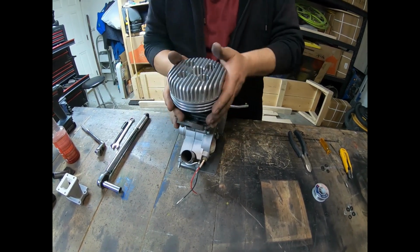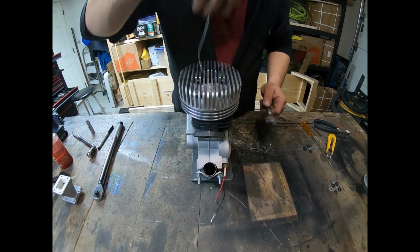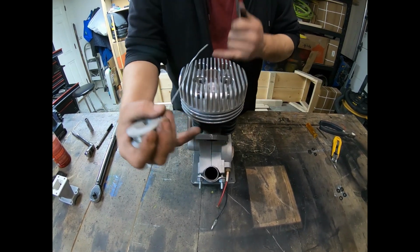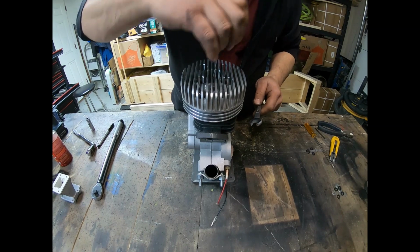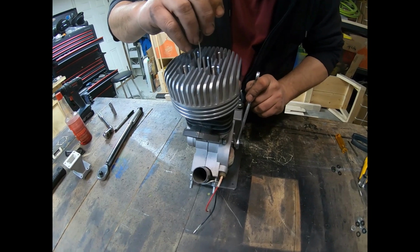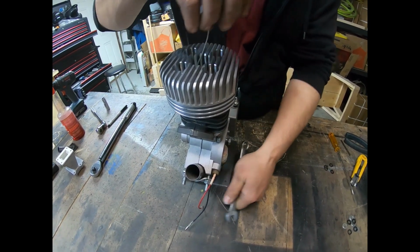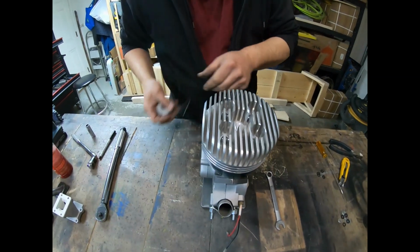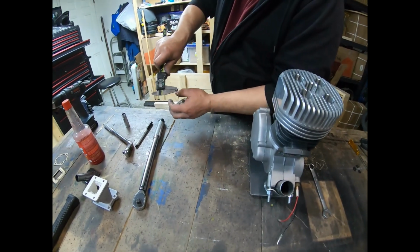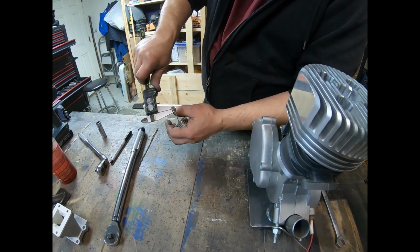Okay, we got our solder here. We got a little bit of curve into it to get the side of it. What we're going to try to do is get onto the pin, not this way, because you could have a slight bit of rock in your piston. So I'll put that in there and turn this over. Get the squish. Okay, there it is, and we'll measure that off. Okay, after I squished my solder, we're checking it here. I'm at 0.9 already, so that's pretty good. I shouldn't have to change anything with it.